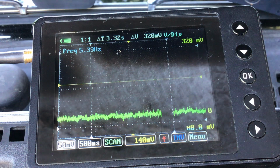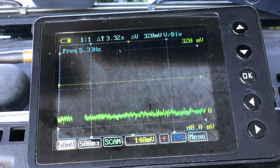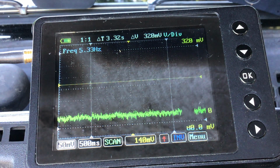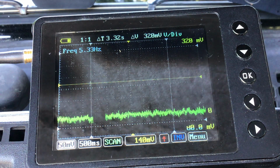So anyway, this is just a quick way to, basically the gist of all these videos on the scope misfire, is if we checked everything, we ruled out our fuel, our spark, and our compression testing led us to consider we may have a valve issue, because we saw something in relative compression, we saw something on the vacuum pulls, and we saw something on in-cylinder cranking or running, and this is just a way to look at where our intake or exhaust valves may be leaking.